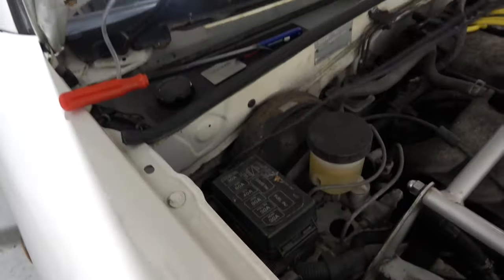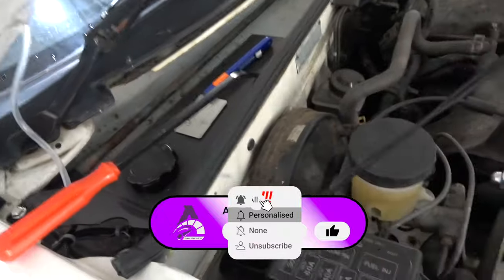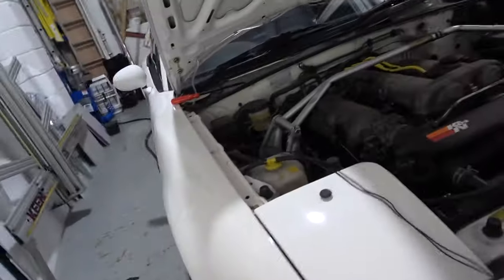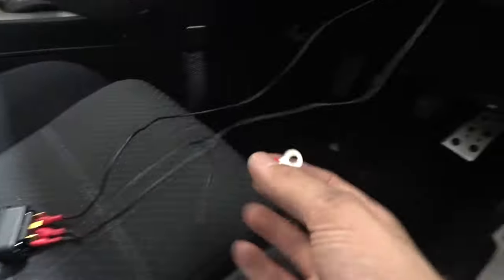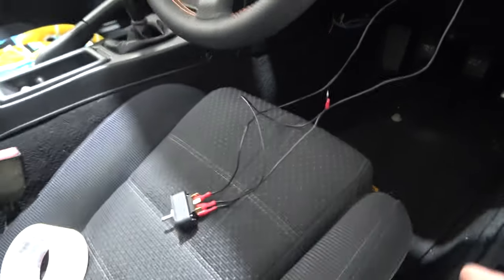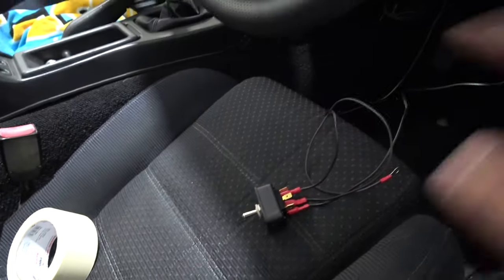Just like that we have got the cables into the engine bay. Now carefully carry on pulling that through because it is a sharp metal edge down there. I'm going to run the bung through those wires and get that sealed back up before I forget. The remaining cable just goes to a ground on the steering column, which I'll figure out in a little bit - I want to get these connections done first, then find the ground and test it before putting it all back in.